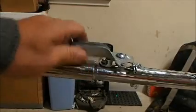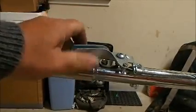Now we test it — here is the cable and the whole assembly we made, very simple parts. As we move the throttle gently, the cable going through the back moves the throttle from the back of the governor. Keep in mind that overriding the governor is not a good idea, so do not over-pull to increase RPM as this might lead to engine damage. Just use it for normal function at a gentle level.